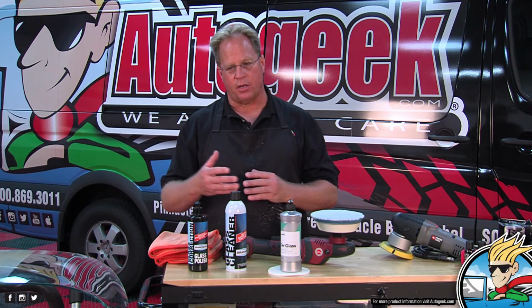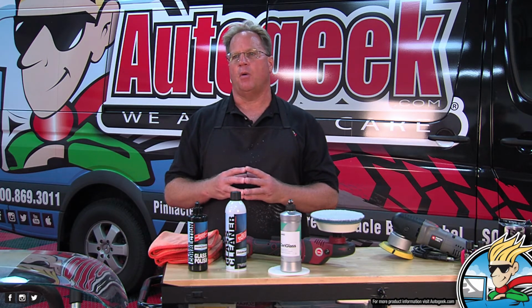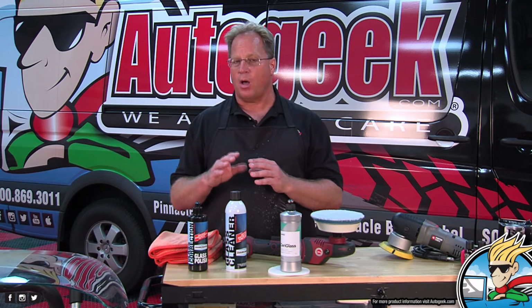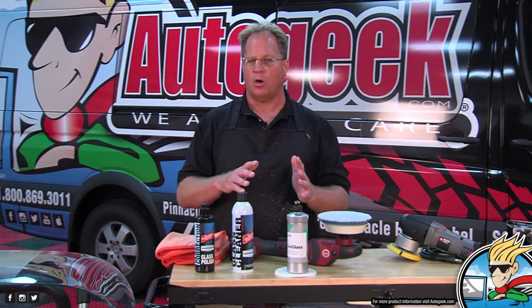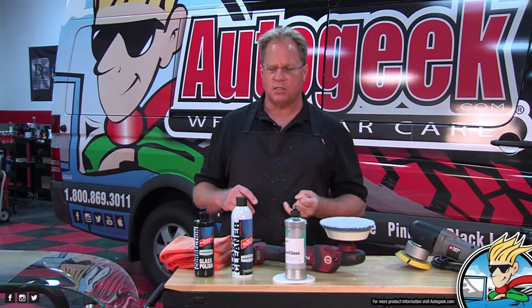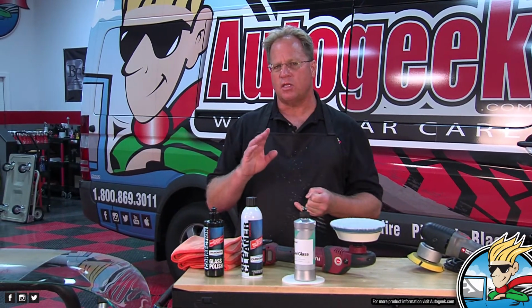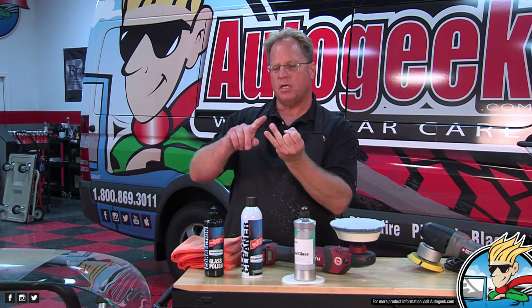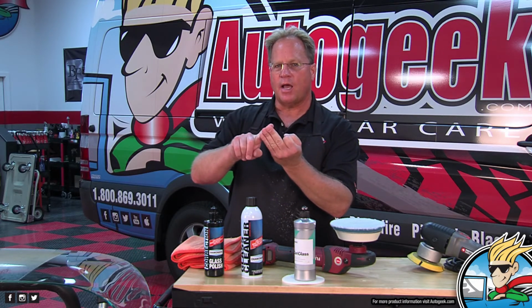So one of the things that I practiced, and now later in life I teach, is always machine polish the glass. And also, here's a little tip, always do it before you wash the car. 3 of the things I teach in my detailing class are always do the things that make the car messy before you wash the car. So engine detailing, headlight correction, glass polishing.